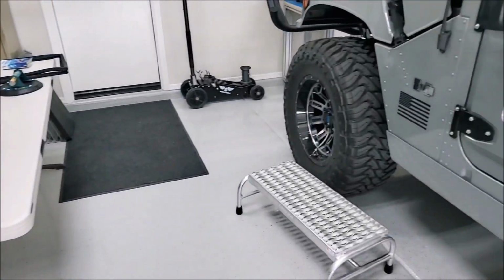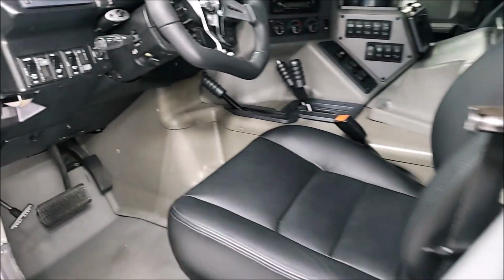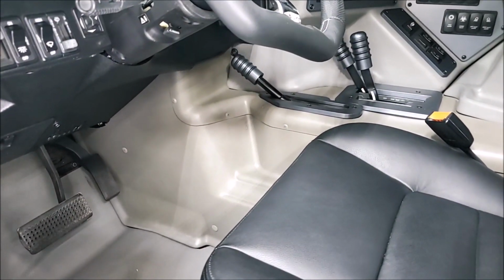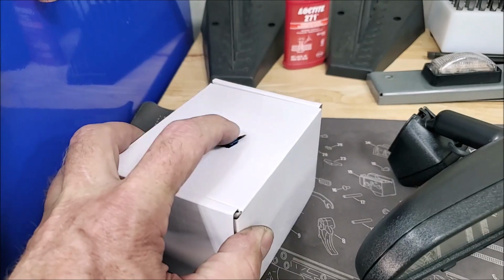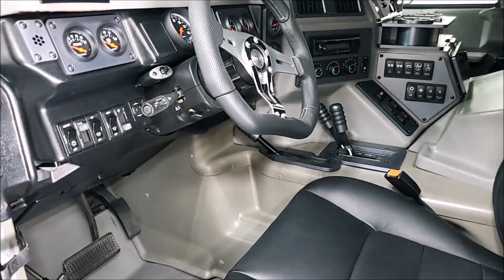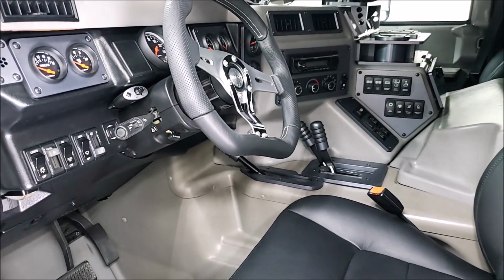And on the inside, oh, another thing I was going to mention, if you're working on a truck for long periods of time, there's a lot of interior lights in these trucks. I mean, one, two, three, like five or six of them, seven of them. So I always make a habit of pulling out the fuse for the interior light. Would have been nice if they'd have a switch in here to turn your dome lights off. But we all know that AM General was not about comfort.